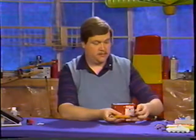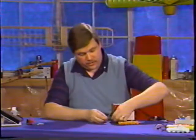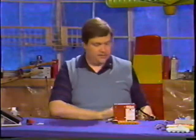All you have to do with this charger is take this cord with this little copper plate on it. That's the heat detector. You rubber band that to your battery pack, like so. Connect up the appropriate charge cord. Push a little red button on the side. The light lights up. Real complicated, right?